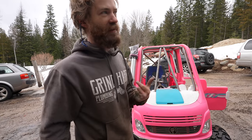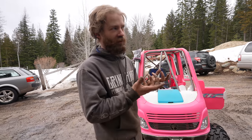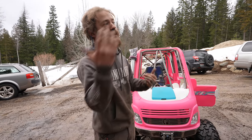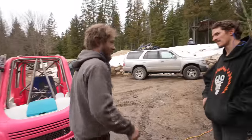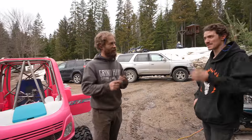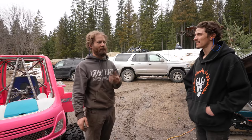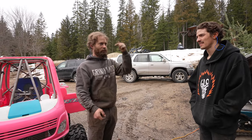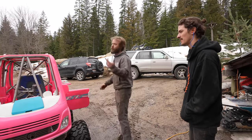I suspect we may be having a big problem with the intake boots. I sprayed some brake clean to see if they were leaking, but maybe they only leak at high RPMs. Because it idles fine. And with more vibration, they loosen up. So I think that might be part of our problem, because it would be pulling in a bunch of air after the carbs, which would make it super lean. So we'll do a short test drive.